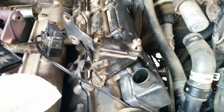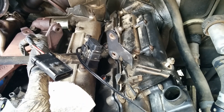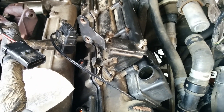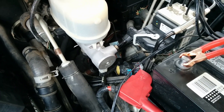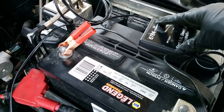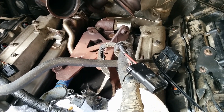Many people would be doing repairs for injector leaks — dummy plugs or standpipes. I did the dummy plug on the driver's side just now because I had it all open. But check this out: if we actuate the IPR, it closes off and it's absolutely silent.